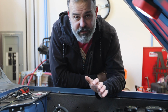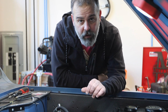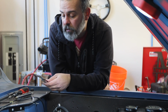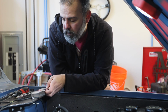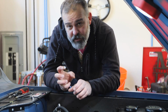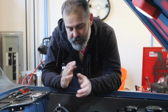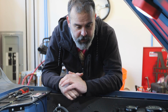It's a really brilliant system because you can do a lot of tuning without having to open the top of the carb. All I did was unscrew that and swing the door out of the way. So I'm gonna go ahead and swap out the five inch mercury with the 7 inch mercury. And what that does is it makes it so you gotta have 7 inches of mercury to pull that metering rod down. Not five, five is hardly any, right? So 7 inches of mercury. And so basically it means that it pulls it out of the orifice sooner and you get more fuel put in. That's the bottom line.